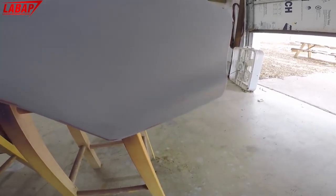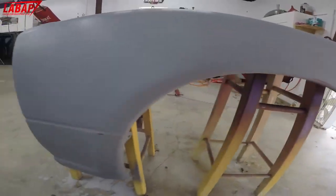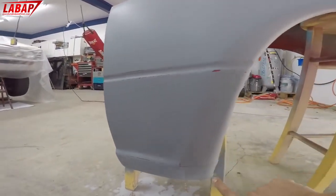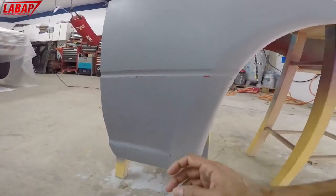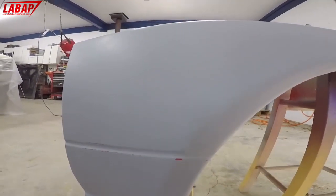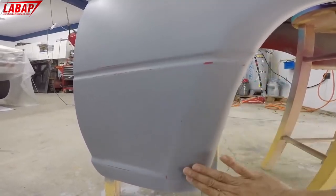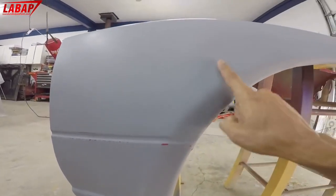You gotta make sure to sand them flat, all right? And that we didn't do here. So don't expect the ultimate $2,000 paint job here. If you look down here, this is the undercoating, and you can see how it's orange peel. Another thing you could do is really load it on with 2K primer here, and then block sand it flat, which will get you this type of result. In some areas, you can see that it is getting to be like that. If we continue to block this out, we might have enough primer on here to basically get it to a glass finish like this.